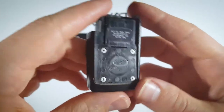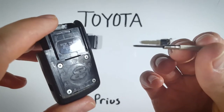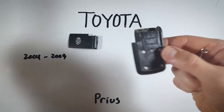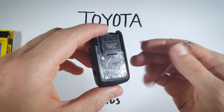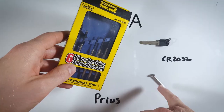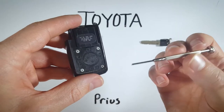Now here we have a little bit of a hurdle to jump over. You will need a small screwdriver, small enough to remove these little Phillips head screws. The only one that worked for me was this very small precision flathead screwdriver that was just the right size. Something larger — even some of my other precision screwdrivers — felt like I was stripping the screw. Try to use what you have lying around first, but don't put too much pressure; if you strip these screws you won't be able to change your battery. I'll put a link in the description for this product if you are interested or do not have the right tool.